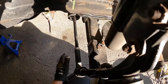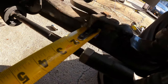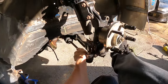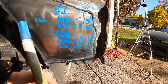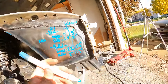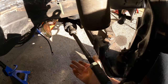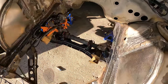I put a light layer of black paint on top for now, and I'll probably get it powder coated over winter. Just by looking at it with the knuckle straight, you can already tell the inner tie rod is way closer to parallel with the lower control arm. Taking the measurement at the same marked spot on the control arm at full lock - we went from the previous measurement to about an inch and a half. The outer measurement is now half an inch forward at the outermost point, making it much closer to parallel even at lock, which overall is going to help your driving experience.